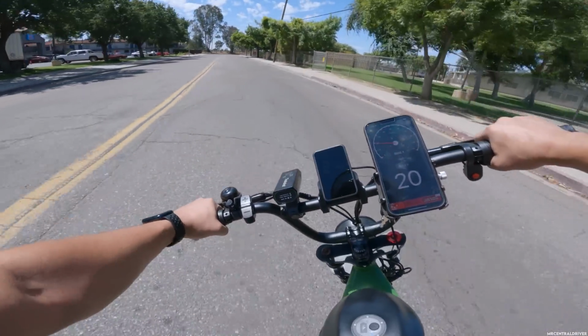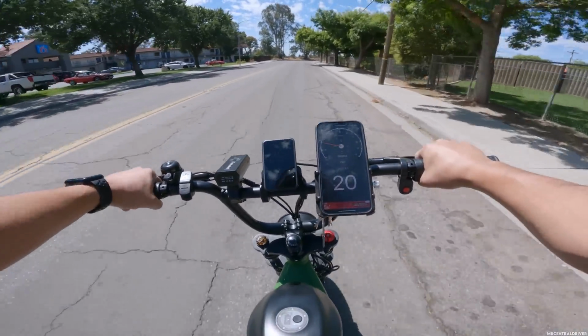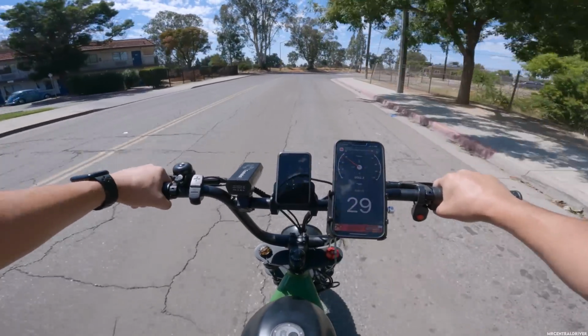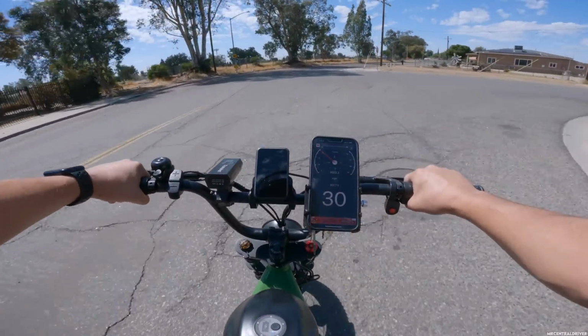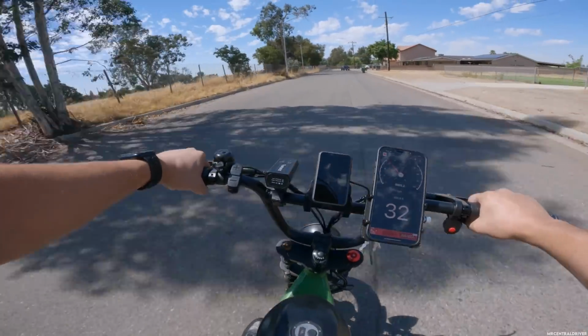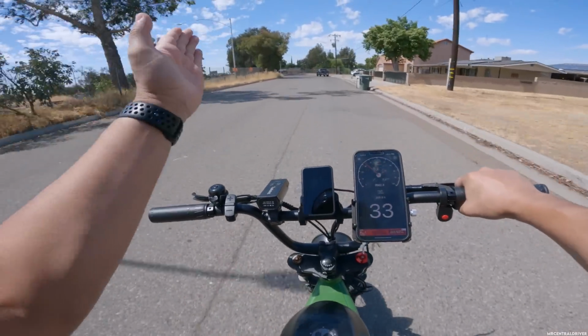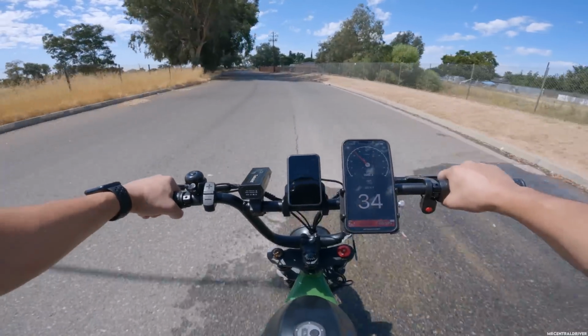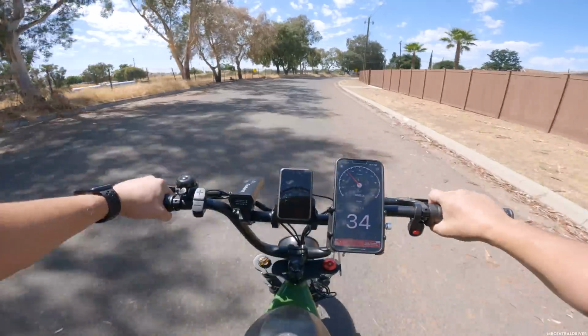But I will say you gotta be kind of careful because there is a little tiny bit of a window on here. It's not as gradual, 0 to 100. It's not like, oh, 10% throttle is 10% throttle. It's kind of like you do 20% throttle, nothing's really happening, and then in between like a 30 to 40% window of pulling the throttle, that's where you have your movement of 0 to like 100%.